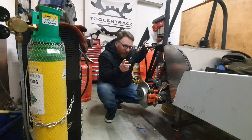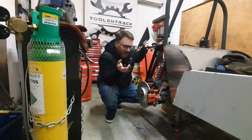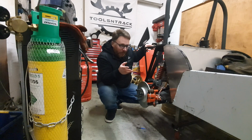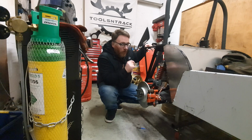Now, stop and have a wee think about this for a second. The fronts are bolted up and spin. Why wouldn't they fit the backs? Well, remember there was a big song and a dance I made about this, that I wanted the SVT, i.e. the biggest brakes that ever came on an MX-5. That means 280mm discs in the front. It also means 281mm discs on the back.